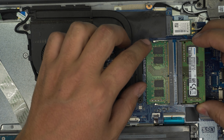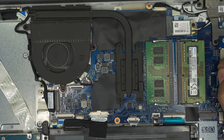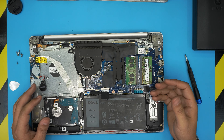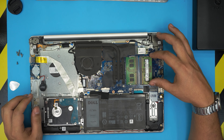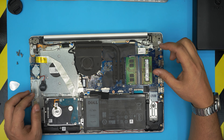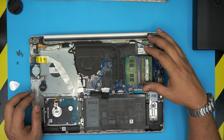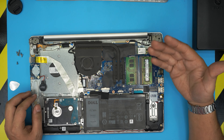Once we remove all the screws — and these three screws at the back row are not supposed to come out entirely — with those screws loose, we're going to open the laptop to about 45 degrees. We're going to grab the opening tool — in this case the guitar pick — and stick it between the bottom cover and the palm rest. You just twist it backward like this, working your way to the corners, then the left and right sides.